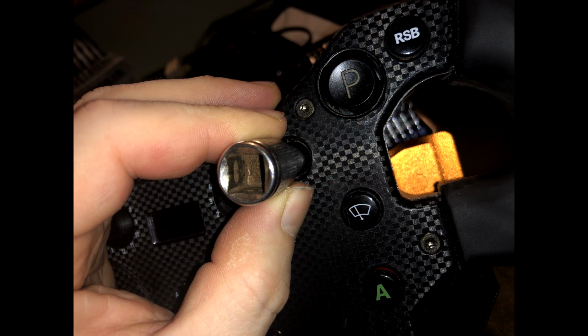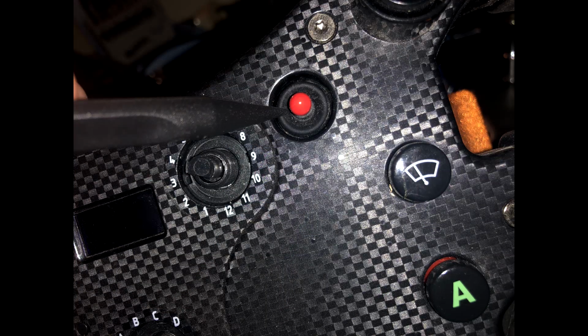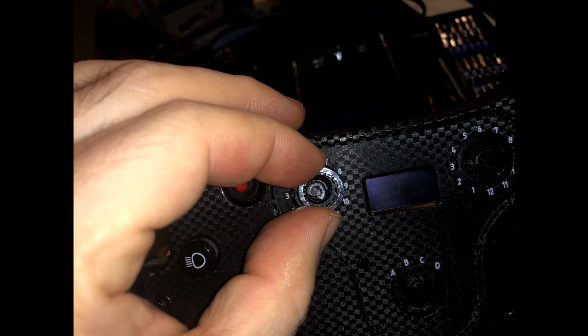Then the lock washers, then the 8mm nuts. Do them up just finger tight with a socket. The rubber covers just slide over. I push them down into place with a pointed plastic tool. Don't use a sharp screwdriver or you could tear them, just be gentle.